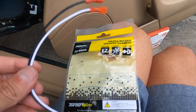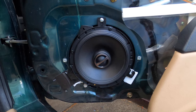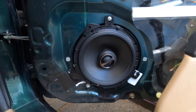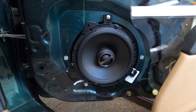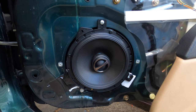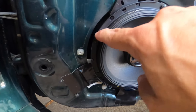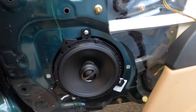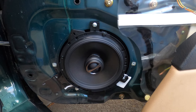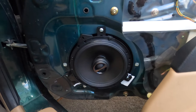These adapters for the door speakers are pretty handy — worth just a few bucks that they cost. Wouldn't be too hard to tap into them or splice and cut them, but this is just so easy. Here's the passenger side — all finished. I gave it a listen. Sounds great. The clarity is much better, much more crisp, less distortion. However, it has lost some bass. A few possible reasons: one, it's smaller. Two, the Bose speaker was 2 ohms, so it was probably getting more volume from less watts. And I think the major thing is that there's now air through here — it's not a tight seal as the Bose speaker was, so it's probably less bass response due to the more air volume. But this didn't cost me anything to do it this way, and down the road if I want to get a better adapter or fill this, I can — it's literally five minutes to take the door off.